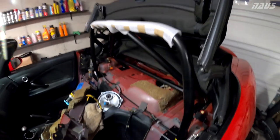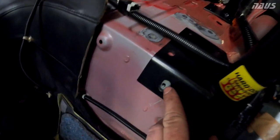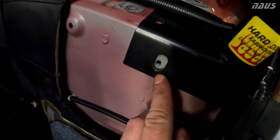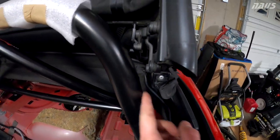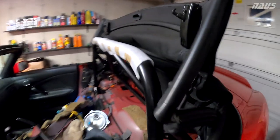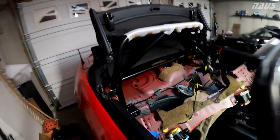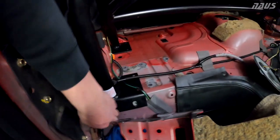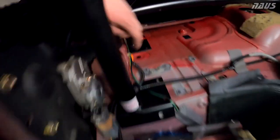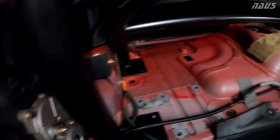After a little bit of fiddling around, I got it aligned and centered. What I'm going off of as a gauge is not only the holes aligning at the edge of the slot — about the same amount on each side — but also the soft top. The clearance between the roll bar is about the width of my index finger, and taking it around to the other side, that gap is about the same — pretty much dead nuts centered. I wanted to show you guys the routing of these harnesses. It was a little tricky; you've got to pop some clips out. I popped my ABS sensors for the rear wheels out and pushed the grommet down to get some clear sliding action without fraying those wires.